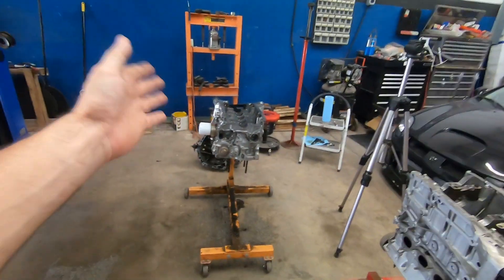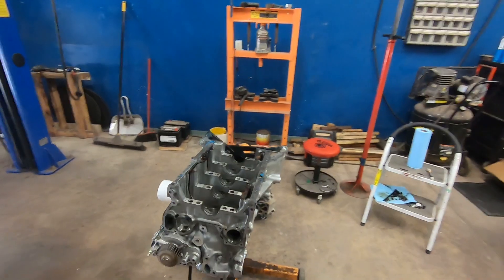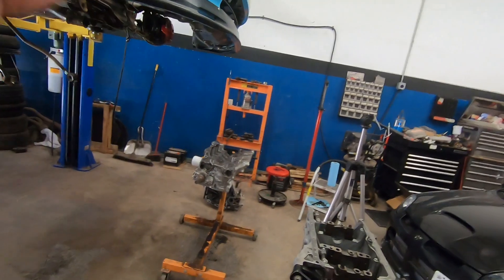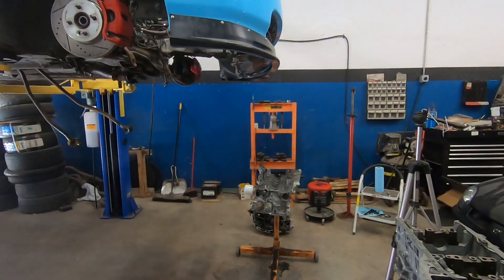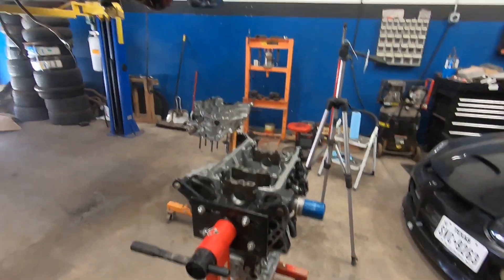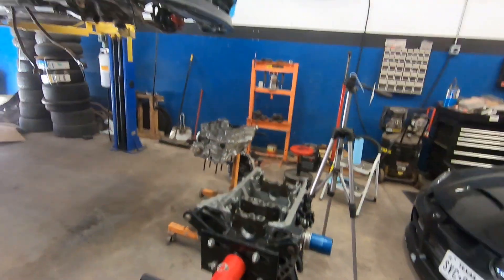We've got the H22A on a stand like the A4 we just tore down. Looking at the cylinder walls of cylinder four, you can definitely see the wear - there's a lot of scoring going on in there. Cylinder three is not as bad but there are a couple of line grooves in it. This confirms you just can't put aftermarket pistons in and bore out a stock sleeve - it won't last. It'll self-detonate, chew itself down. It only lasted 500 miles and started smoking terribly. You have to sleeve H22s - you have to do it. I learned a valuable, expensive lesson on that.